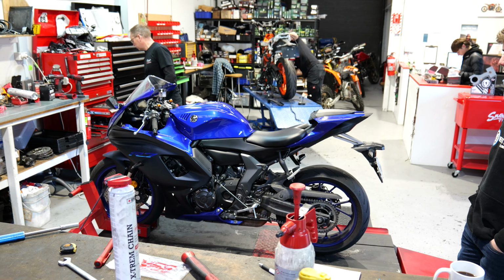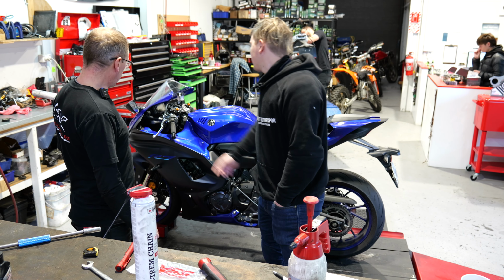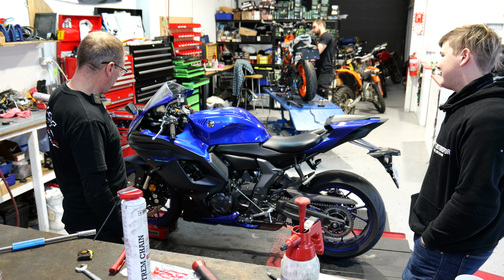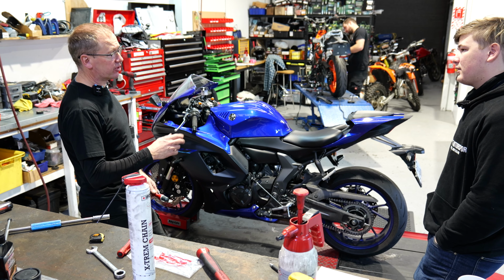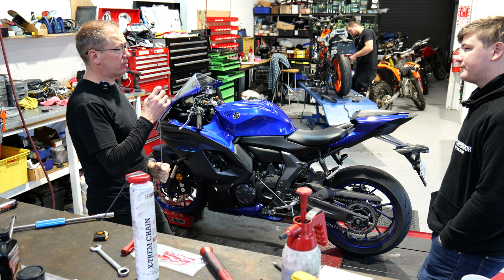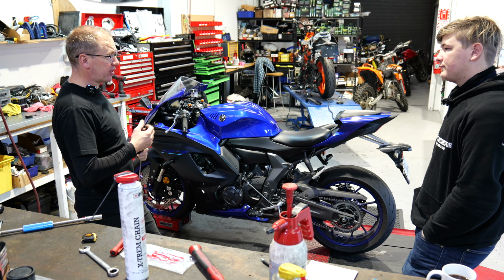He was having a problem with adjusting it and the front bouncing, but I don't think he realised you are able to adjust this. Yeah. Well, that won't affect the damping, that's the spring. Yeah. But the problem is when it's so soft, you're so far through the travel of the fork before you even start adjusting it that the damping is, you're just overpowering it. You're in effect asking the damping adjusters and the oil flow to be the spring because the spring's doing so little. Yeah. So all I've done is increase the tension on the spring. Yep. And so it gives you a bit more control to start with.